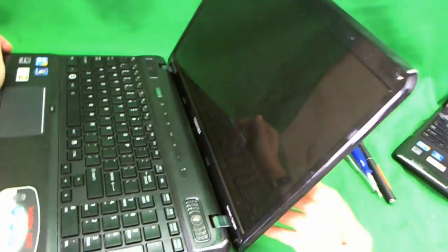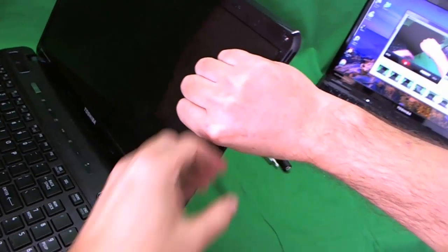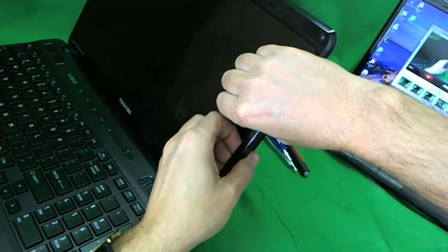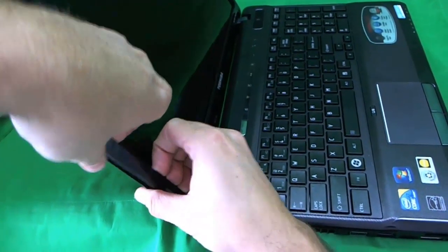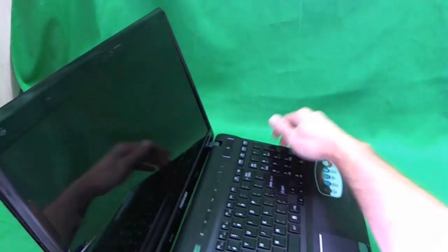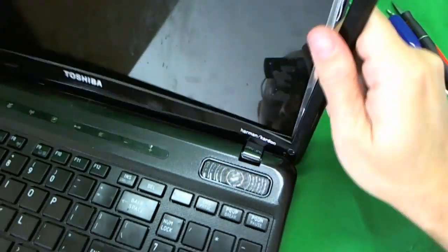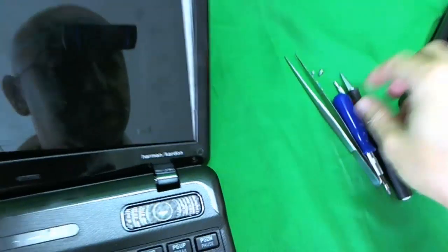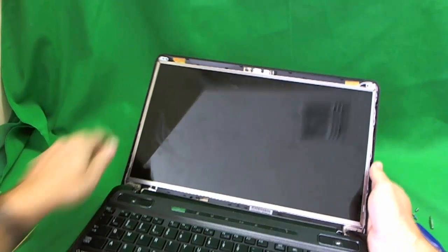Here comes the trickiest part of the job — taking off the plastic frame without damaging it. What I like to do is go from the screen side and lift it up with my fingers. Once you start hearing the snapping sound, that's good. Work your way around it; if a part doesn't want to give, just move on. Sometimes corners are a bit tougher. If it's a little stuck at the seam, you can help it out with an X-Acto blade. And it's out — put that to the side and look at the screen.